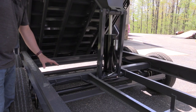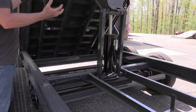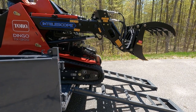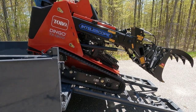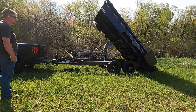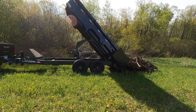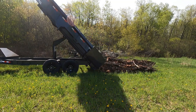Looking down here in the bottom of the trailer, we have a very large heavy-duty I-beam frame, and that allows us to sit this box right on top of it and get a 28-inch deck height in the back. That is important. I didn't want to go with drop axles — you can get some that are a four-inch drop, which would give you 24 inches of deck height, great if you're putting a big skid steer in there. But horrible if you have to dump, because when you dump you'll end up pushing this trailer right to the ground, and even though the dump angle is there, it's really harder to get your material out because you're so close to the ground.